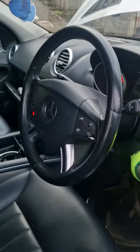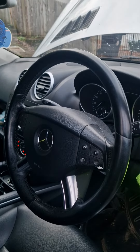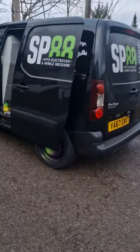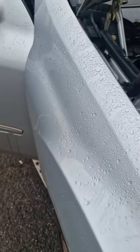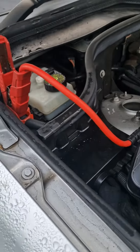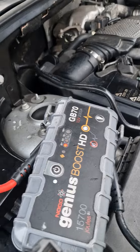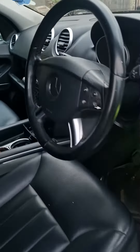Currently ignition - yeah, nothing. She's dead. So put the live on first, that's how you use it, then put the negative on, press the on button and it starts working straight away. This one doesn't have a display to show you the voltage.